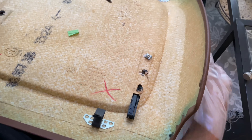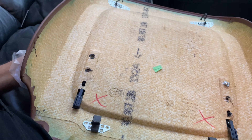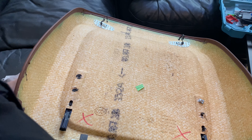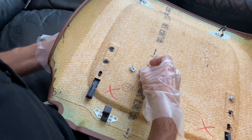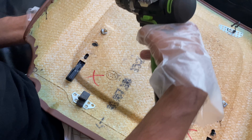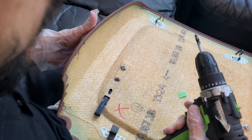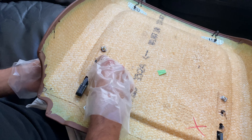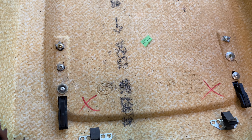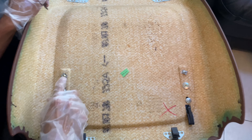We are just putting the pouch back to the rear part of the seat. Put all three screws in on both sides — three and three — so you need six screws and six washers for one seat, and a total of twelve for both. Put the other four also. When you put it in make sure it is in position and tighten it, but don't over-tighten or it will break the plastic.